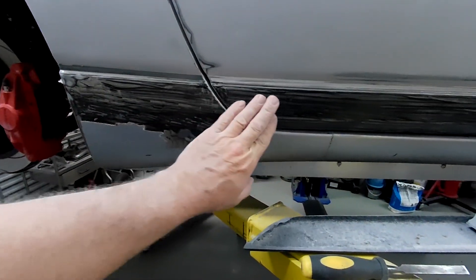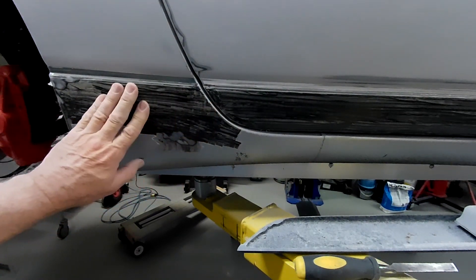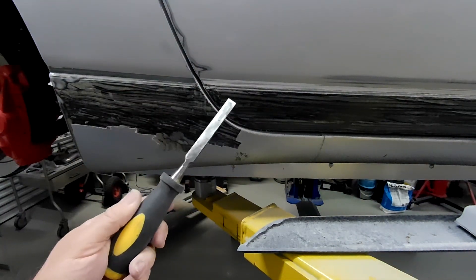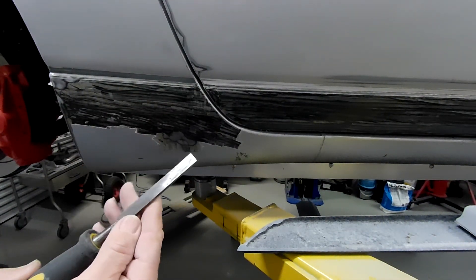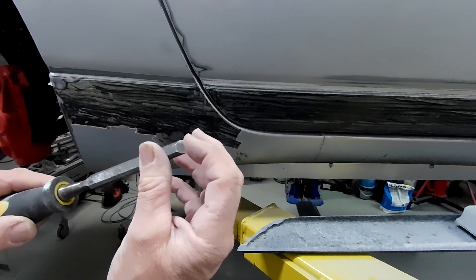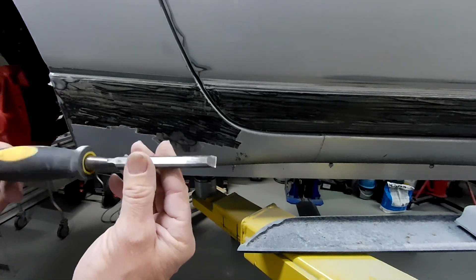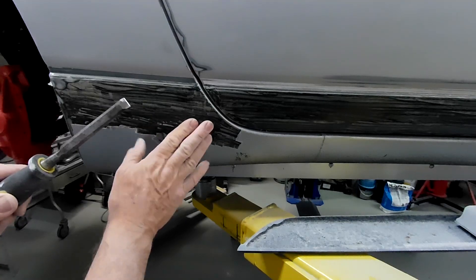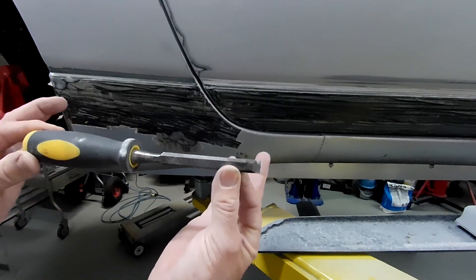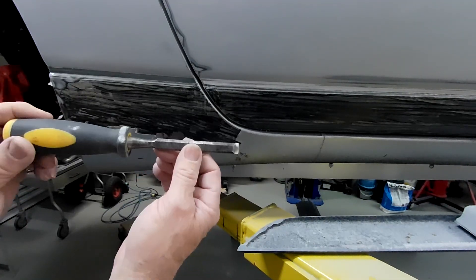As you can see here, you've just got black e-coat underneath. From the factory they obviously spray this rubbery stuff on there first and then paint over it. The way I've found to get rid of this stuff quickest and easiest — get yourself a nice sharp chisel, maybe 12mm or something like that, reasonably sharp. Doesn't have to be razor sharp — you can always knock the corners off if you're a little bit concerned about it digging into the panel. The best way is to just use a sharp woodworking chisel and peel this off.